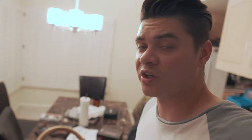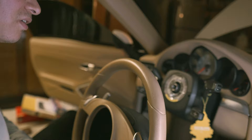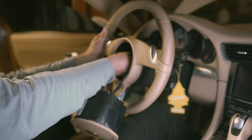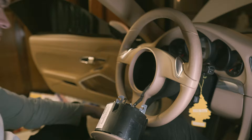We have the whole wheel reassembled other than putting the airbag back in. We're going to bring this back into the car and put the wheel on. This is what the paddles look like when they're installed — they don't have the little retainer cap it used to have on the back. The most crucial part of putting your steering wheel back on is making sure you put it on straight. We know the wheels are straight because we made them straight before we put it on.